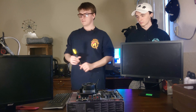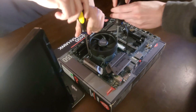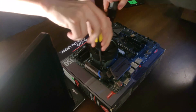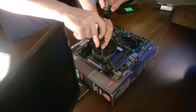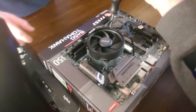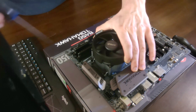The thing to be really careful about with these AMD CPUs, as I'm sure you discovered putting it in, is that they have pins on the bottom — instead of being like an Intel chip, all nice and friendly with pads. I'm still not sure which mounting mechanism I prefer, because with pads the damage can come to the motherboard, which is typically cheaper to replace but also takes a lot longer to do.